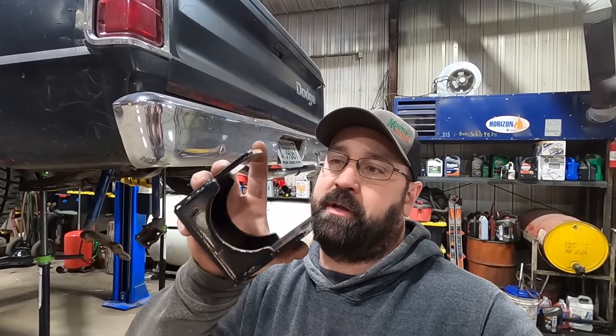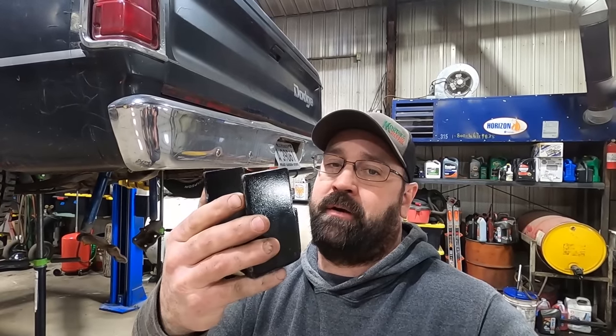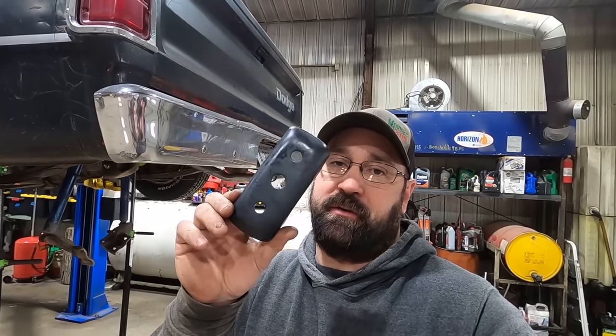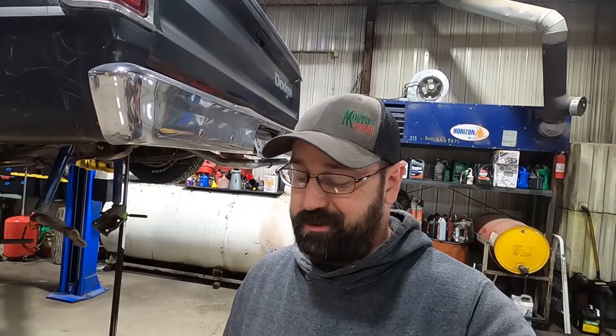All right. So I had a meeting of the minds with the Duff. This thing is the same length, so we could cut one end off to get the right pitch of our pinion angle. These guys are what you really should do, but the spacing is wrong for centering our rear end, which we never really centered before. But you gotta offset it when you flip it. You gotta move it back a hair. And then you should drill.